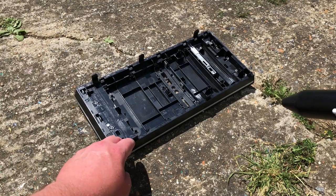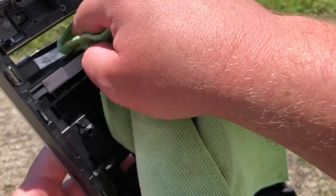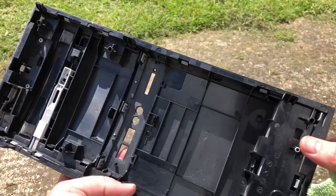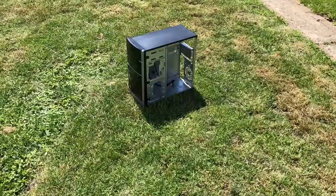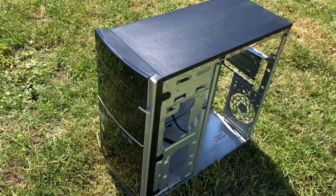How a case looks won't affect performance. The front plastic panel that we removed earlier to get to the DVD drive can be cleaned the same way — a simple matter of placing it outside, firing up the air blower, and then removing the more stubborn stuff with a cloth. A small brush like our makeup brush might also come in handy for accessing awkward curves and corners. With the case cleaned, it's time to deal with the internals.